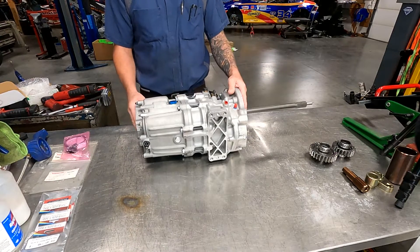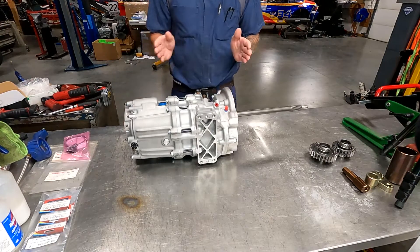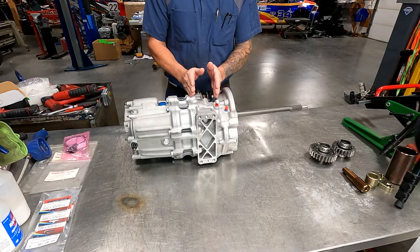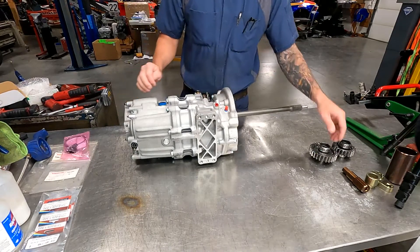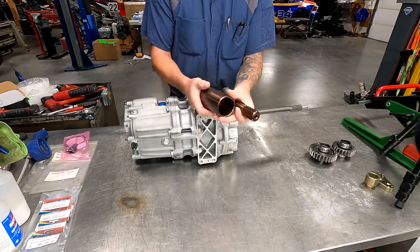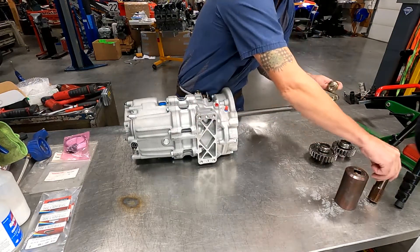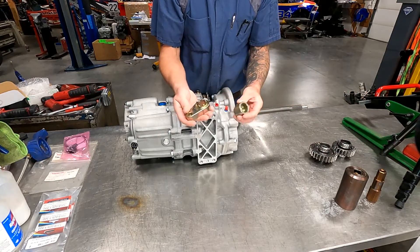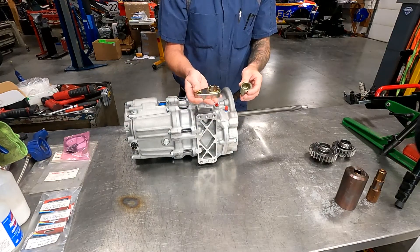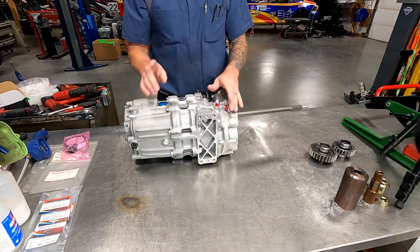So what we're going to do today is I'm going to show you how to change the drop gears in one of these X-Track sequential transmissions. It's actually pretty simple. We've got a section here in the front where the drop gears reside. And then if you were to change the gears inside, we would have to get into the back. To get into the back — which we're not going to be doing today — I wanted to show you all these neat tools. Very custom special tools for each process in order to get into the back of these transmissions. Fortunately, just to change drop gears, we don't need any of this, but we do have them. Sometime when I get into one of these, we'll do another video on that.